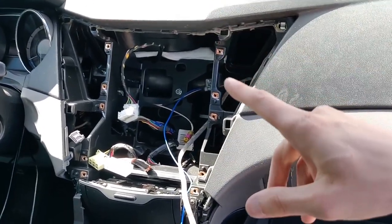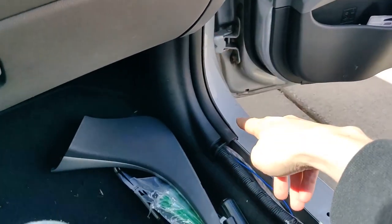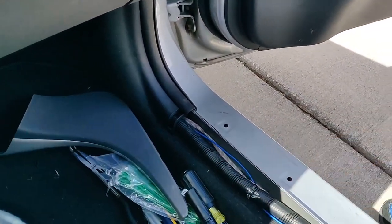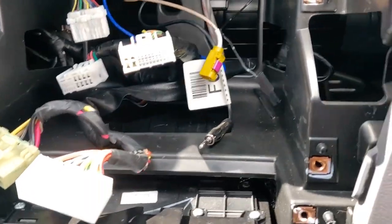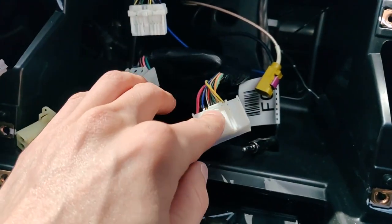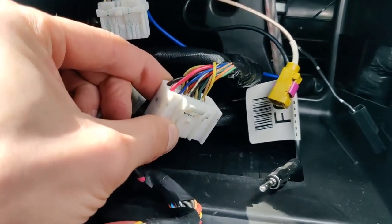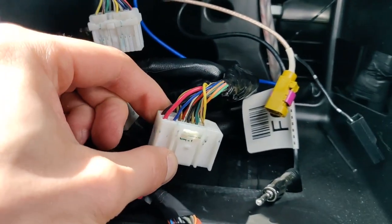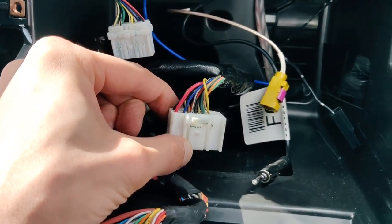As an update, I got the glove box back in, and there was a side panel that I put back on along with the trim piece. The wires had to be run down past the B pillar, and then back into the subwoofer, wired in. What I did up here was the power lead — the blue wire that comes with most amp wiring kits. That taps into the main power connector here, which I believe is all audio. Right next to the main power wires is that blue wire, which is generally your switched power, so we tapped into that.